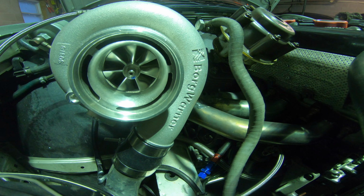I think the biggest issue with turbos is the back pressure on the turbine side. That really is the issue with my 35R. For how big the compressor wheel is, the turbine wheel is just not big enough. I'm pretty much at 33, 34 PSI. It's starting to get at the 1.1, 1-to-1 ratio for the exhaust back pressure to map pressure.